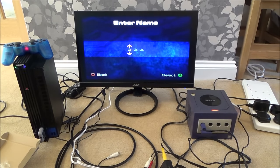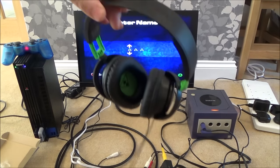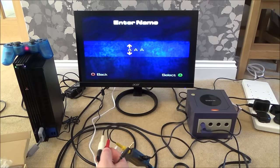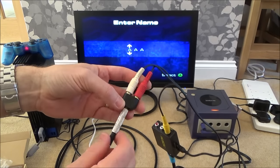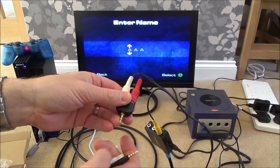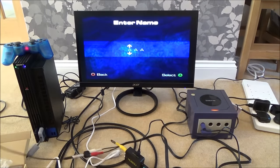Or let's say if you wanted to connect your headphones straight up to it — I've got my wired headphones here. It's only going to work for sound, you're not going to be able to use the microphone. What you can do is unplug this from here and get yourself a little 3.5mm to 3.5mm coupler, plug that in, and then plug your headphones in. You might well be able to get two RCA Phono to a female adapter, which saves you having to convert from male to female. Either way, there are ways to get sound out of it.